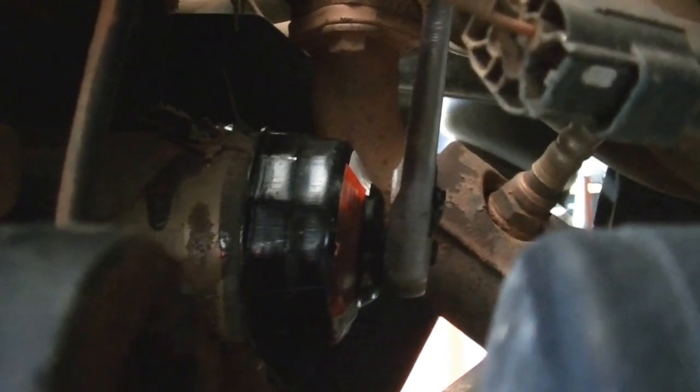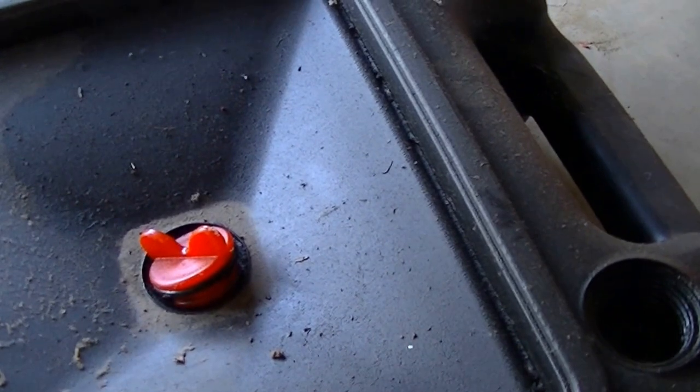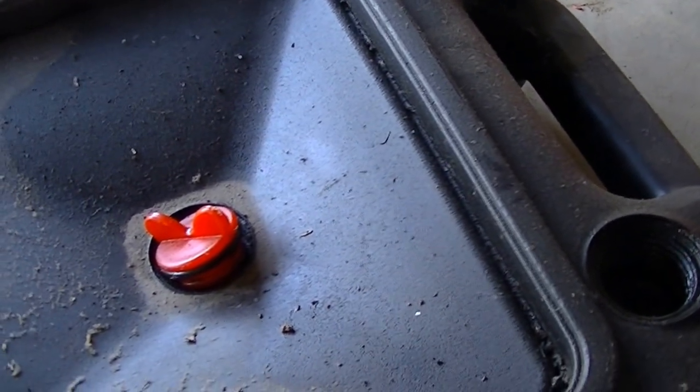The challenge on the 825i — not only to get to the oil pan drain plug, but also the challenge is to get to our oil filter. It's a very tight fit. I recommend getting an oil filter wrench, and what we'll do is get in here and ratchet it off. From the factory, these are really, really tight, which made it extremely difficult to get off. One trick to keep from dropping your oil plug into the bottom of your drain is to place the cap in the drain. I'm going to take the plug loose right here, and we're going to drain the oil and let the plug fall because it's going to make a mess.